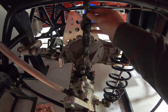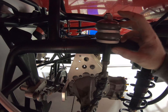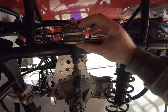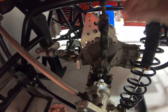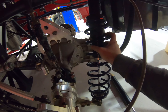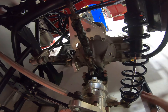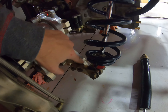Now this chain — when you're adjusting drop — you want to make sure you've got some sort of bushing system in here, because you don't want it to be rigid. When it hits up, it slams in there. You want some cushion so you can have some absorption of that hike if it hikes real violently. But you don't want your shocks to catch to keep the car from hiking. And if you are having problems getting the hike you need, you need to either run a drop bracket, or change the cam rate right here.